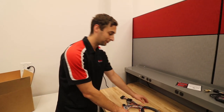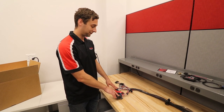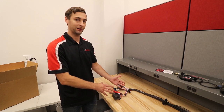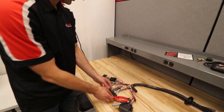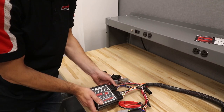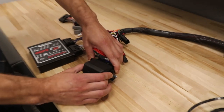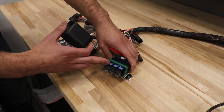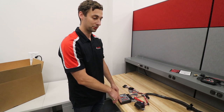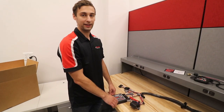This is the grommet that will go through your firewall. This harness was designed so that the ECU and relay module all fit in the factory location in the passenger footwell of the 944, or under the dash or somewhere inside the passenger compartment for a universal application. These are the two connectors that your ECU will plug into — just slide it in until you hear a click. This is the power distribution module; squeeze the two tabs on the side and pull off to reveal three relays and three fuses — for your main fuse and relay, your enable fuse and relay, and the third relay for the fuel pump.